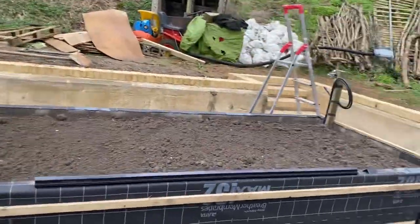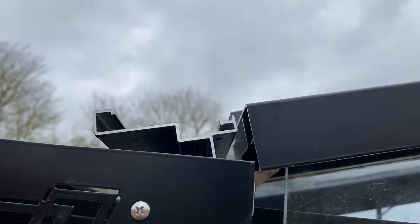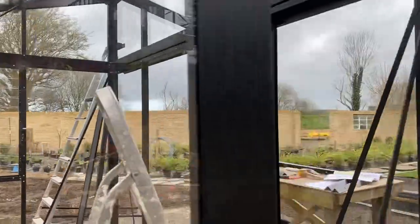The secret I found is: don't put the roof window in yet. Slide the roof glass upward — it goes into a slot, sliding up and dropping down, with the slot being 10 millimetres. So I put in a 14 millimetre spacer and slid the glass up by 14 millimetres, putting it in the highest position it will reach.